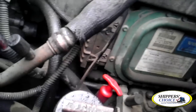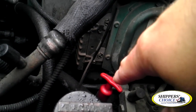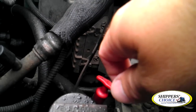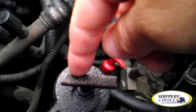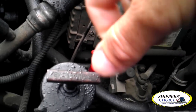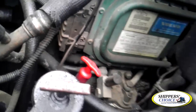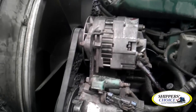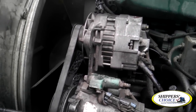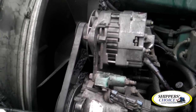From that point, I'm going to check my oil dipstick and oil fill tube. Here's my dipstick — if I were to remove it, I'd wipe it clean, reinsert, pull it back out, and check the level. If it's low, I'm going to refill here. The tubes are not cracked, bent, or broken, and you don't see any evidence of leaks. It's not necessary to pull those out on your test. As a fallback, I'm going to check all my belts at this time — none are cracked, dry rotted, or broken, and no more than a quarter inch of play when I push in the center, or three quarters for Maryland or D.C.